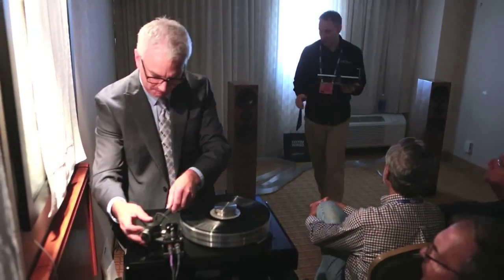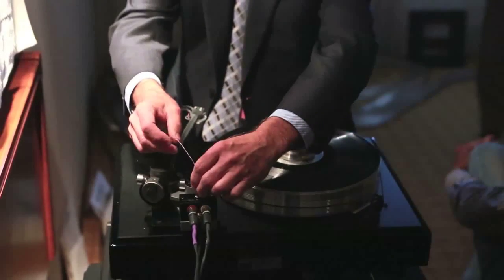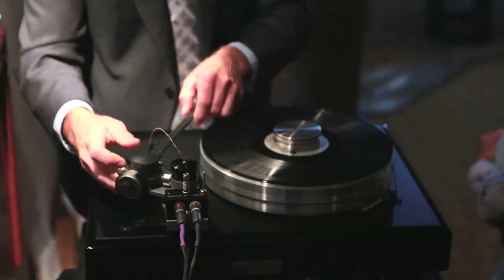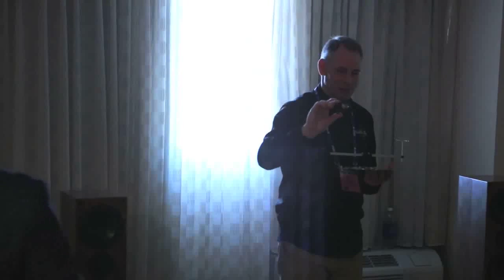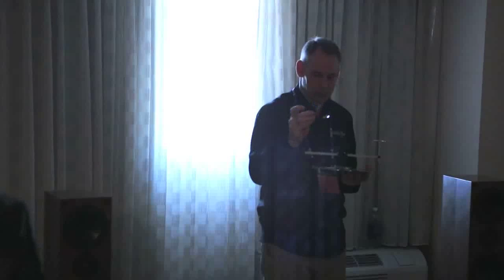And the ways in which this is more precise, it's not rocket science. They give you three spindle collars of different diameters so that you can get the protractor really snug on the spindle of the record player. So there's no slop there, because that will introduce error. But the most important thing about this is the loupe. I think this one's actually a thread counting loupe from a fabric manufacturer or producer. But this enables you to see what the hell you're doing. It's as simple as that.